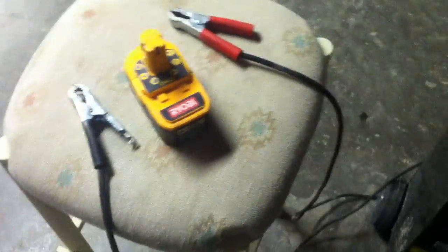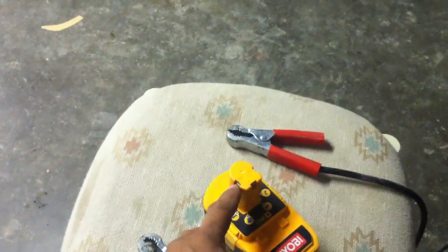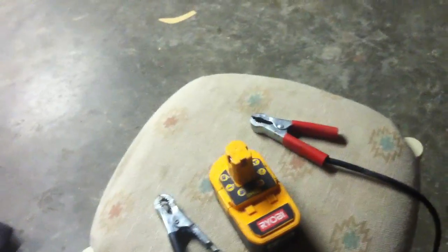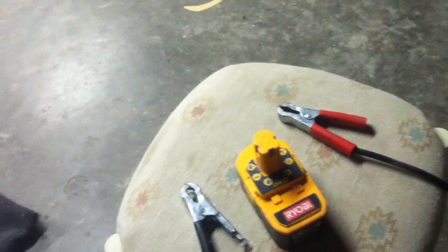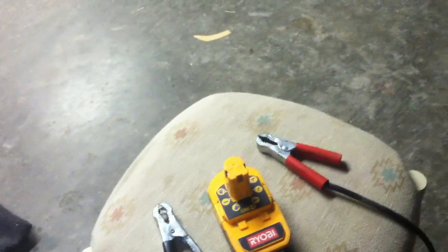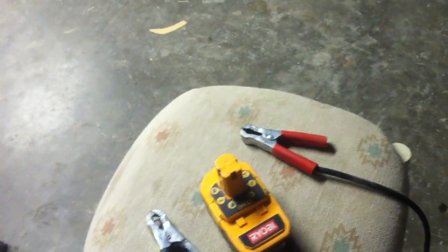They all work. And the reason they work is because when these batteries die completely, there are two reasons they die. One, of course, you've overused it. Two, the little prongs are not touching. So you might check those and pry them out — it'll show a defective battery if those are not touching. But the main reason is because we use them, let them sit, and they die completely and won't take a charge again. Inside the battery builds up little crystals, and they don't allow it to take a charge anymore. It's kind of a rusty point in between the connections.